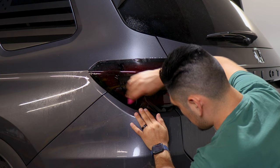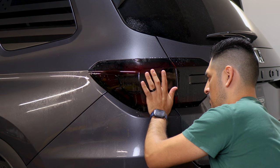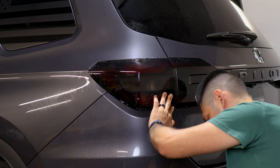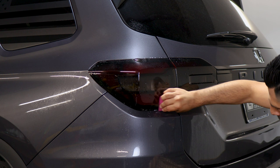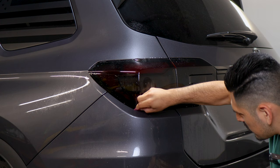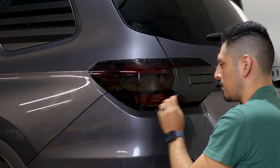With the film stretched to the edge, lift carefully and apply tack solution underneath and on top, then tack this whole section down with the squeegee. Secure this section first, then stretch the film up to the final edge and secure that end — this prevents the film from lifting. Stretch down first, tack all the way down, confirm everything is good, then stretch again to meet the final edge. Remove all the solution on the film. Any small fingers remaining will be removed with heat and tack solution.